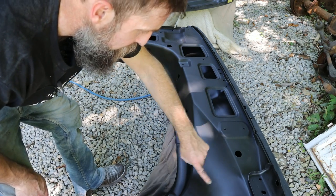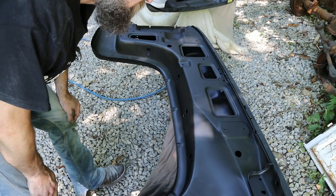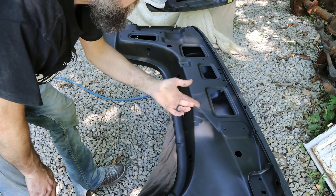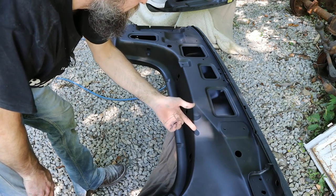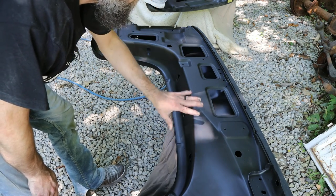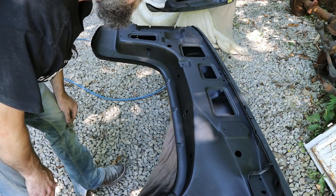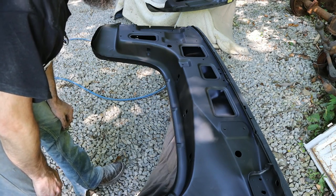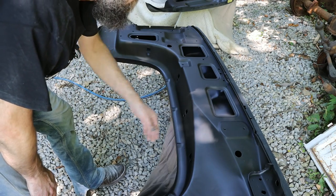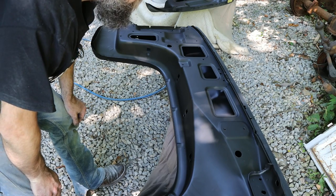Man, some people are doing that, and it looks pretty good. Check out how nice that finish is. There's no gloss to that. It's just a nice satin finish, but there's nothing wrong with that at all. So you can get this stuff in white, I think, as well. And I'm not for sure if you could tint it or not, but there are people out there who are spraying their whole rides in this stuff, and in certain circumstances, it looks pretty dang good. So if you want to just get your vehicle in one color on the cheap, that epoxy primer is definitely a real option.